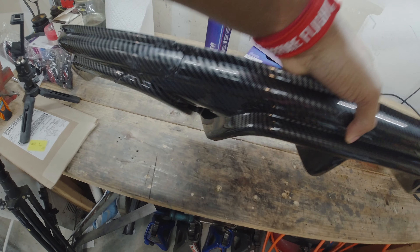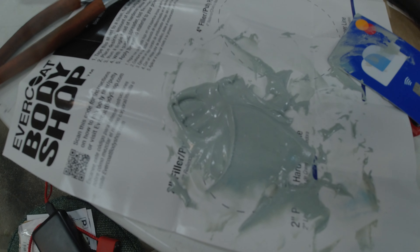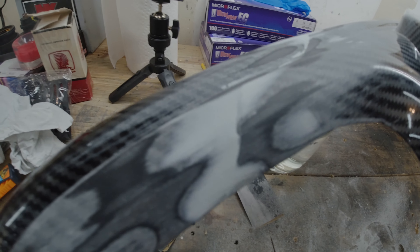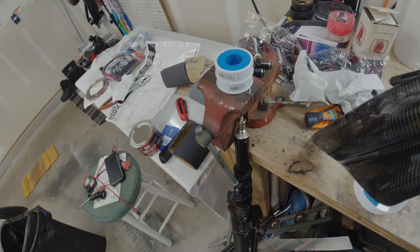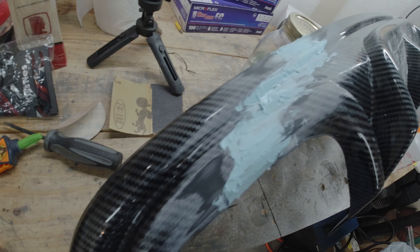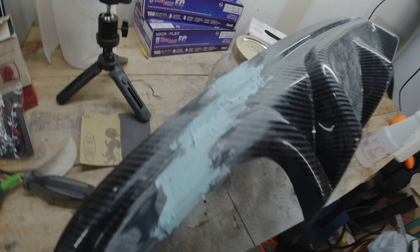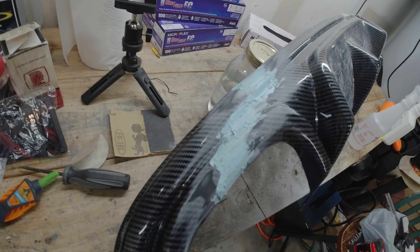Today is Tuesday and we're leaving Friday morning. I got the hardener mixed and let it set up for a few minutes, then spread it thin on the diffuser. First layer on, let it sit for 10 minutes, then sand. Body filler was 80 grit then 120 grit, and this is pretty smooth, so I think I'm done with the body filler. Going to hit it with the pro-grade glazing putty very thinly — we might paint this tomorrow. We have our glazing putty layer on. This is supposed to sit for 12-15 minutes, then sand with 180 followed by 320, and then call this done.